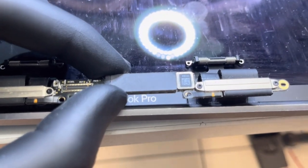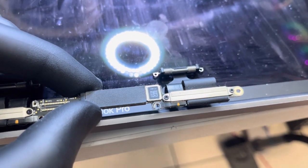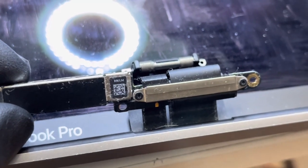So because of that, we end up with no 55 volt going to the display. Probably the camera doesn't work as well. So really it's a design issue, and this is widely known. Assuming we've got the display outside the housing, we've got the T-Con nice and exposed. You can picture that the T-Con sits here along the body with the display closed, and as it starts to open, the T-Con actually turns. That's where you'll see that the cable's nice and flat, and as it starts to turn, that break reveals itself right there.